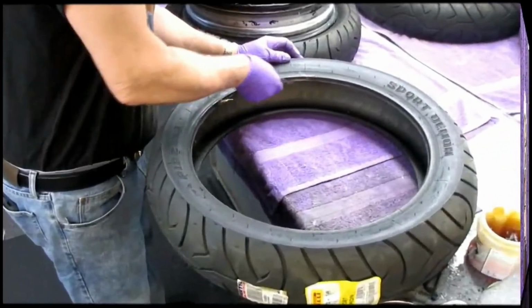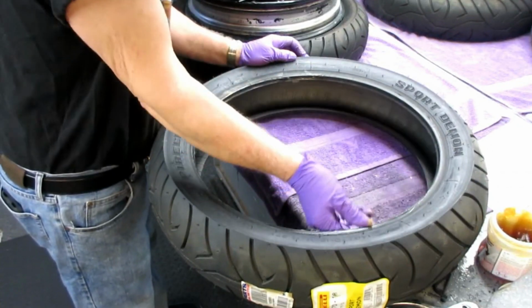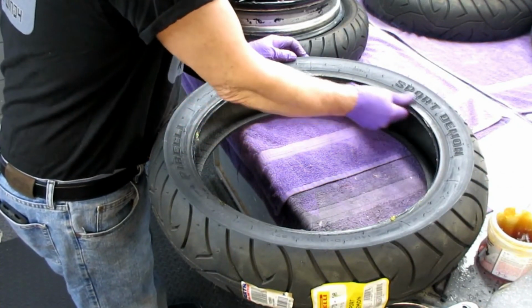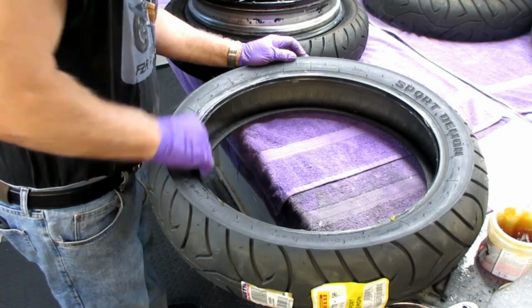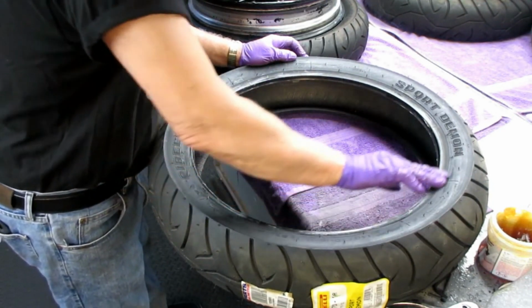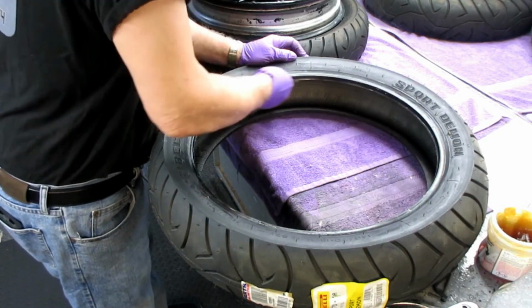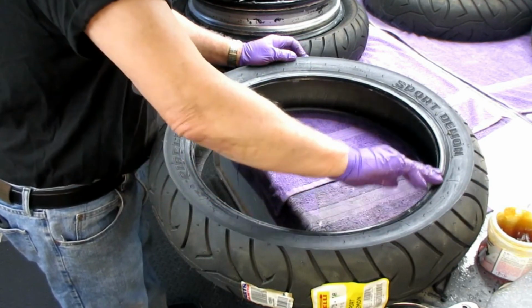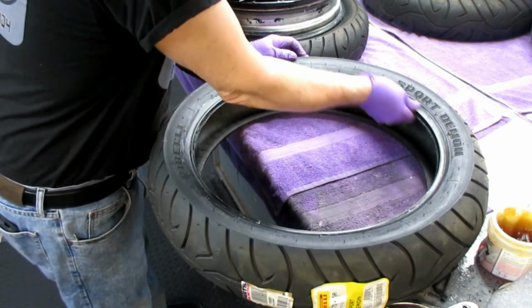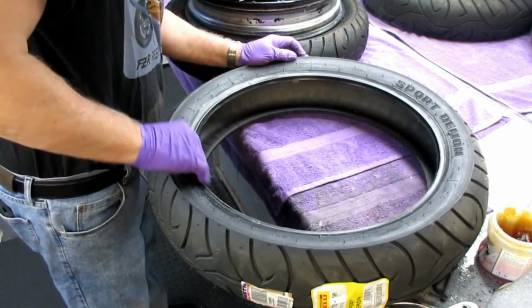We need to, of course, take into account where exactly the balance point is, and Pirellis have a red dot, so that makes that relatively easy. Michelins don't. Some do and some don't, because with Michelin 5s, one had a dot and one didn't. And when I researched that, the Michelin video says anyway, that they reject tires that need a red dot. So I don't know if that's true, but I thought I'd pass that on, and that is on the Michelin YouTube videos that are out there.